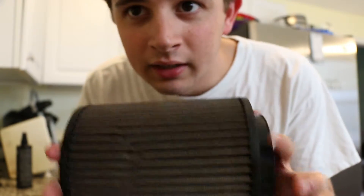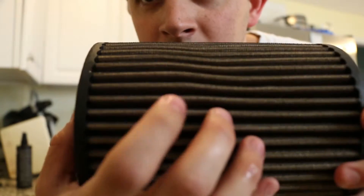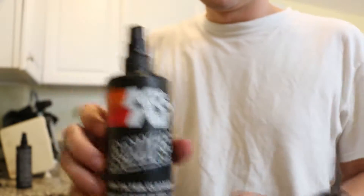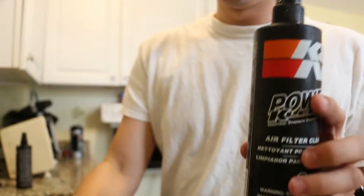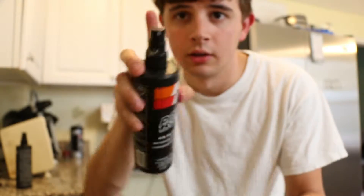What I did yesterday to make this not black — because I did everything to make this thing not black, and right now you're seeing the metal mesh. I used the K&N power recharge kit, which comes with cleaner and oil. You're going to spray it all along your filter and let it soak in for 10 minutes. Do not leave it sitting too long — it can damage the cotton fibers.